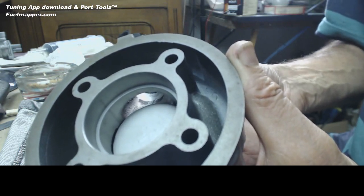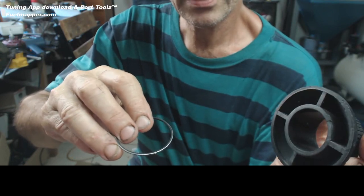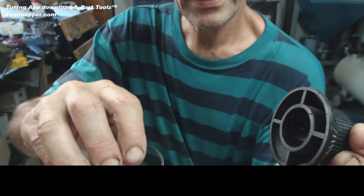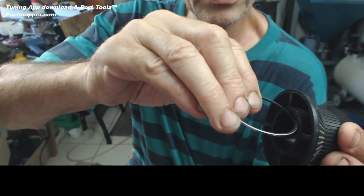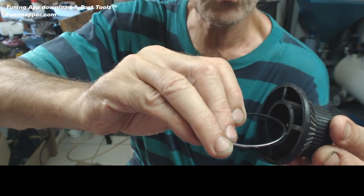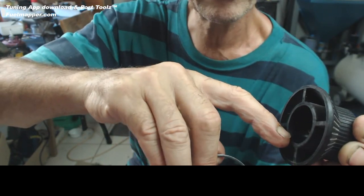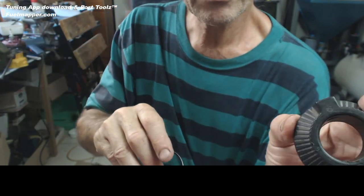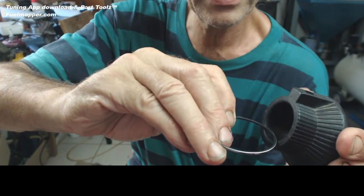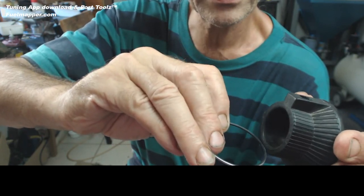It needs to be done by hand before installing the cylinder, and if you don't do it then the cylinder is likely going to be destroyed the moment you take it out for the first ride. We can see this in action here with this plastic collet - on this side it represents the exhaust port and it's got a sharp edge. As the piston ring enters the exhaust port it pushes in and is now in contact at each side, gets to the widest point, rides down and takes out the last piece. Whereas on the other side it's got a nice radius, a nice bearing surface, and it just glides into shape, back into the correct diameter of the cylinder.